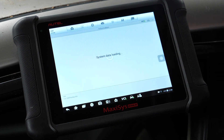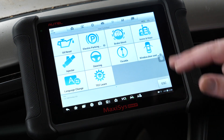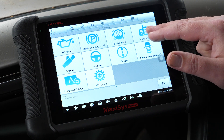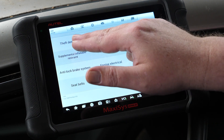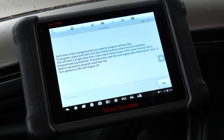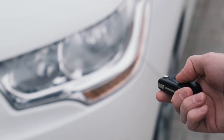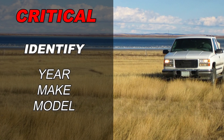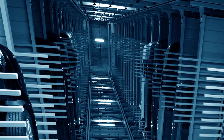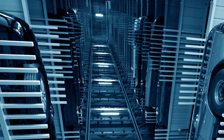These tools can walk you through the procedure step by step. Just make sure you can dedicate 10 uninterrupted minutes for the procedure. One advantage of performing the relearn procedure with a scan tool is confirmation the key has been learned by the vehicle, and the ability to perform diagnostics is a definite advantage. If you do not have access to a tool that can perform this Pass Lock or Pass Key reprogram procedure, you can use the manual procedure that can take up to 30 minutes to program all the keys. It is critical to identify the correct procedure for the year, make, and model of the GM vehicle in the service information. Due to the many GM platforms and model changeovers, it can be difficult to identify which procedure applies.